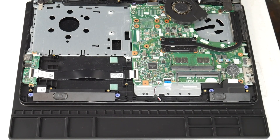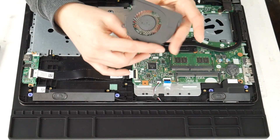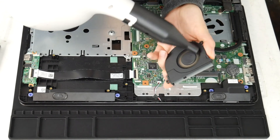I'm going to take a high pressure air cannon. You could also use a hair blow dryer or a can of compressed air — I've included the can of compressed air and the air cannon down below. This is what your fan looks like. If you find it's still loud, this is what a replacement part number for a Dell fan looks like, in case you feel you need to order a new one as opposed to just cleaning it. Sometimes just cleaning it isn't enough — if it's not turning on properly or makes a really loud noise even after cleaning.